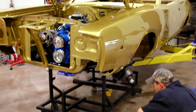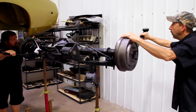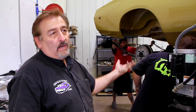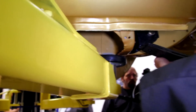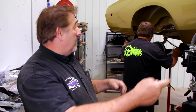Now we've got the front end in place. The rear K-member bolts aren't in — I should have put the rear end in first. Not a big deal though — that helps balance the car out. Right now they're putting that in. This is just a simple 3.23 sure-grip 8 and 3-quarter rear end. The car is a 4-speed, so the guy did order it with the 3.23 sure grip, which is really cool. They'll have the rear end located, then we can raise the car up, put the rear K-member bolts in, button up the back end, and the suspension will be done.